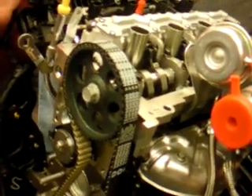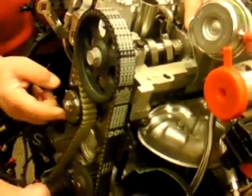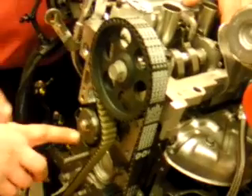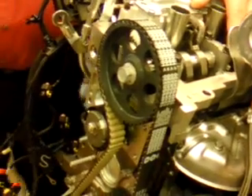Take both of the locking plates off and rotate the crankshaft by hand two revolutions. I'm not going to make you guys rotate it two revolutions, but if you read what the service manual says — the service manual says if after two revolutions that silver tab is not in that slot, start over. On the adjuster? Yep. That silver tab in that slot right there. It doesn't lock in there? No, it just aligns with it. What's the service life on that belt — 100 or 60? 150, I think.